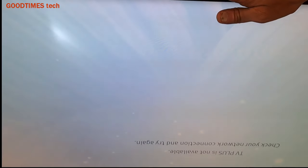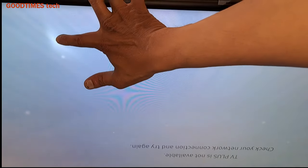There is a white spot here, but it is because of the diffuser. The diffuser sheet behind the screen has gone bad — I think the diffuser sheet has got damaged.